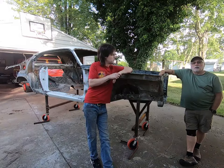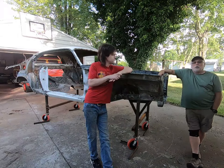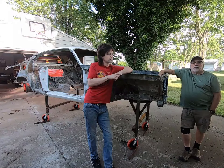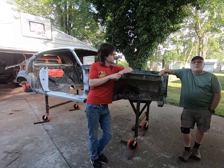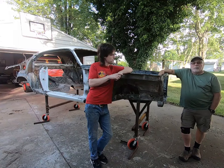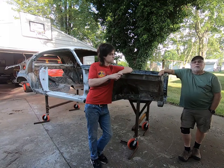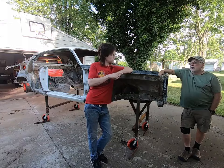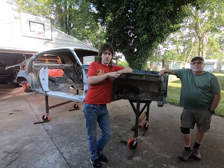What we use is crushed glass. It's food-based product glass, so it's beer bottles, wine bottles, pickle jars that are ground up. It's about the consistency of table salt, but it's considered a natural substance, so it doesn't have to be picked up or anything necessarily, but it does a really nice job cutting through the paint and the rust to make sure that we've got a really nice finish on it in a paint-ready surface. Doesn't leave any residue on the metal when we're done, so basically you blow it off, wipe it off, and it's ready to paint. That's all we really want.